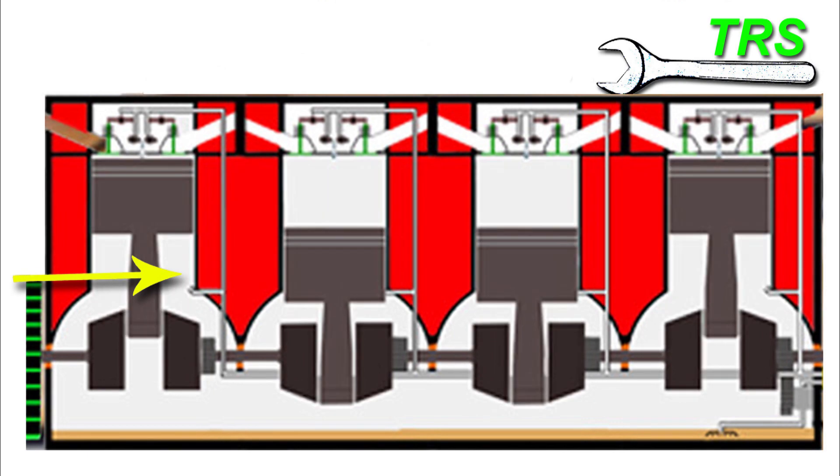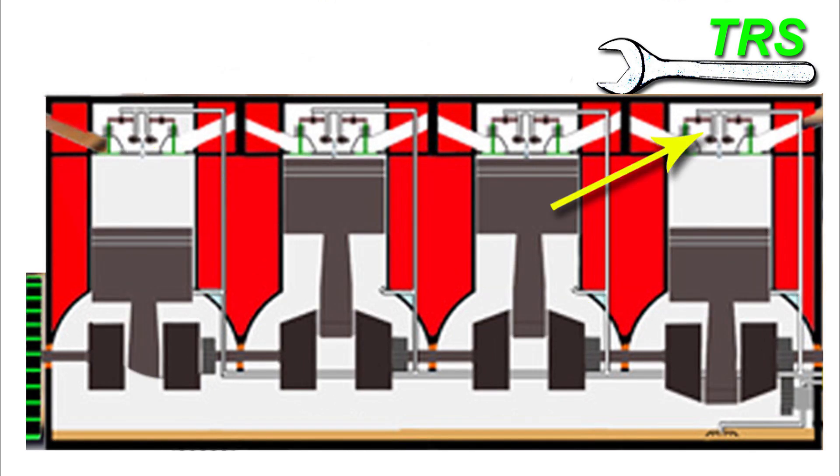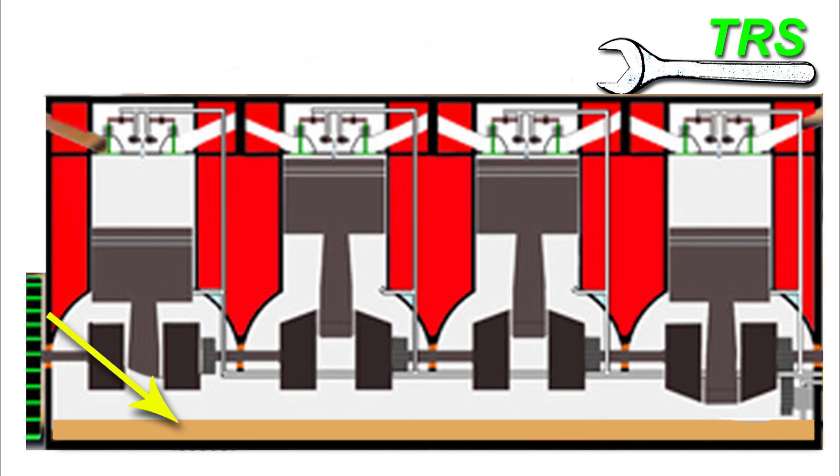Another thing to consider is that when the engine was running, oil was taken up to all the components in the engine. Now that the engine has stopped, a lot of that oil is still trapped between the piping network and some of those engine components. That means some oil is still trapped above the sump, so it won't give a true reading down below. It will show less oil than actually exists. So with the engine stopped on a flat surface, I personally recommend waiting around 10 to 15 minutes for that oil to drop back down to the bottom of the sump.